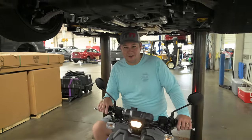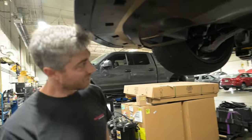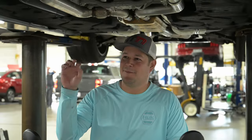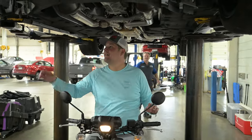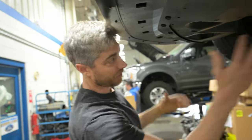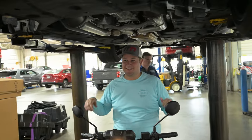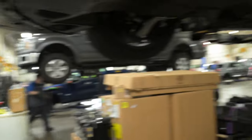It's literally GT3-esque — stuff you'd see on the underside of an RS Porsche or a Ferrari. I took the engineering numbers off the parts to see if we could get some for our 500s. I think it probably helps pull the air that's coming through the radiators out from underneath. Less air under the car means lower pressure, which helps pull the car to the ground. And if you get a lot of that engine heat out, the diff cooler is going to run cooler too — they're probably doing multiple things at once. Got those installed.